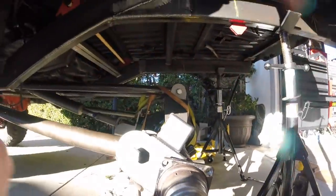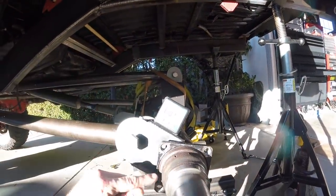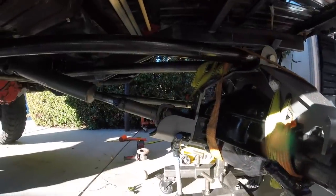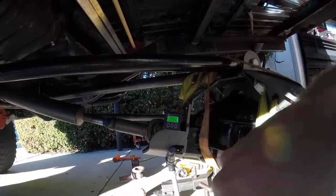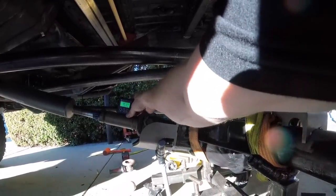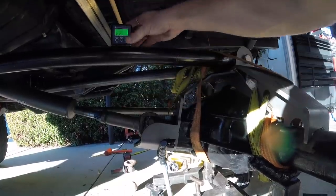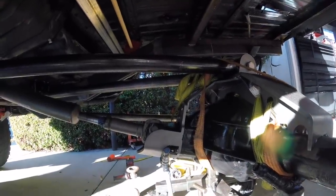I think this is part of my problem — I go for fractions of a degree perfection. I just don't think I'm going to be able to get it, but maybe I will. I just really, really overanalyze things. Right here, this is where these guys want to go — about an inch above axle centerline, 30 degrees on this side. I'll take you over to the other side in a second. I've also locked down the pinion from 12 and a quarter to 15, so about three degrees. That's perfect — that will keep the needle bearings moving. These guys are almost flat at ride height. It's a little bit downhill, so 31 degrees.